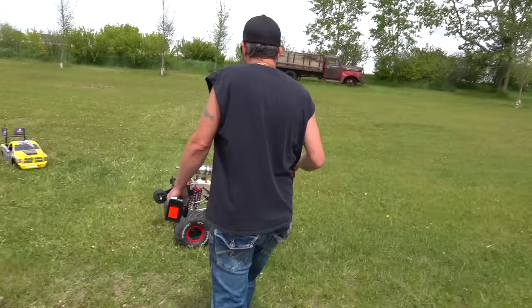Okay, so stock needle settings are 1.5 turns out on the high and the low. And of course, break-in process, new elevation. How many feet are we above sea level? 3,800 feet above sea level. So different oxygen ratio. And so it's just a matter of getting tanks through it and tuning it to where it goes.